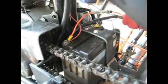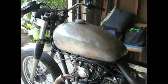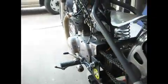Charging system up close. The battery positive lead has two lines: one line goes to my key switch, the other goes from my regulator rectifier back into my battery through the fuse. On the other side, I've got the regulator rectifier dangling from a couple zip ties on the left.